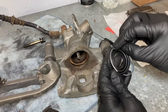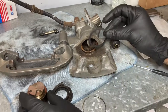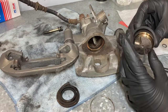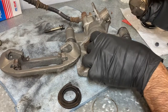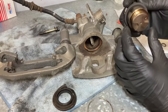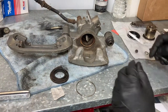I'm going to clean this up a little bit and then reinstall. Regarding the seal and o-ring — this rubber seal goes over the piston right here, and this is what really seals the piston so fluid doesn't flow out. The dust boot prevents dust from getting into the system. This seal should fit into this groove, so we're going to try to get the old one out and put the new one in. I'm hoping it's the right size because it seems a little loose on this guy — fingers crossed it's the right seal, but only one way to find out.